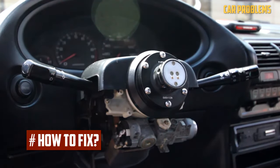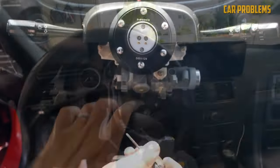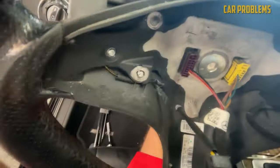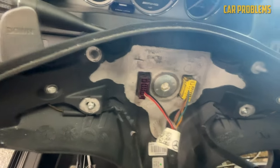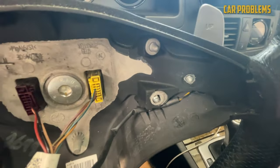How to fix. Once you realize that the car horn isn't functioning, begin diagnosing the issue by checking the ground and measuring the voltage to the horn. Examine the clock spring, fuses, and relays as well. You might need to see a nearby mechanic if changing the horn doesn't solve the issue.